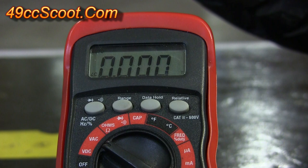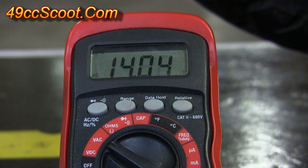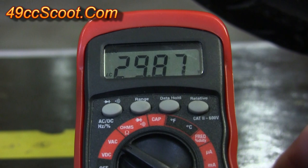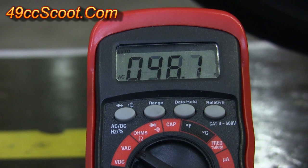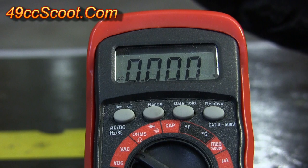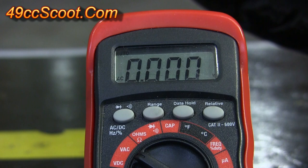Now you need to turn on your multimeter and set it to volts AC. Make sure everything's out of the way of hot or moving parts, and then you can start the scooter. You can see we get something like 15 to 20 volts at idle — my idle is going to act up a bit now because it's not getting any voltage for the enricher. If you rev it up, you can see that it'll peak somewhere around 60 volts AC. So something like 15 to 20 at idle and around maybe 60 or above when you're revving the engine.